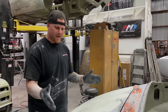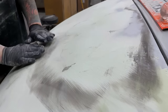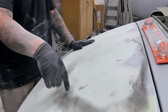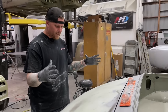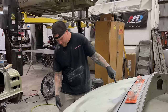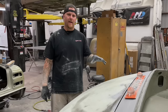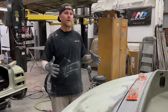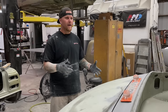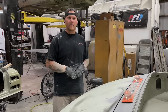We blew it off so you could actually see what's left. You can see how we've stayed in the high and the guide coat is still showing us where we have not come out and affected the areas that were already perfect. At this point you can make the determination - if you see a massive low, circle it and fix it. What was big gets smaller, so forth. All we have left after just a couple passes on this trunk lid is a couple spots - one on the keyhole area. We really did this video to update you guys and show you how good Rage Ultra and Ultra Extra is. It is worth the bang for the buck. You will struggle if you use a different filler that's harder. I do recommend 3M - it just depends on your heat and climate. Do what works for you guys. Continue to learn, share what you know, and we'll see you guys on the next one.